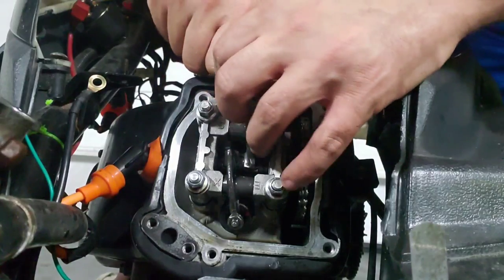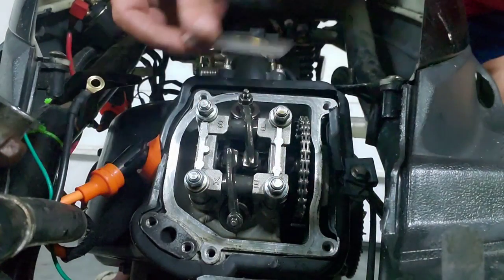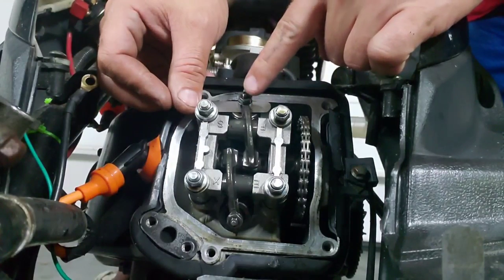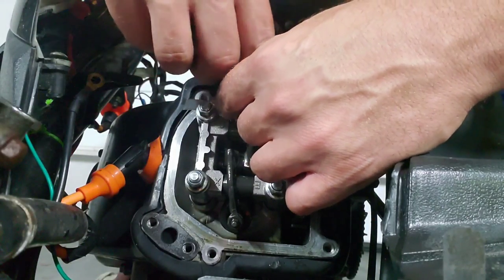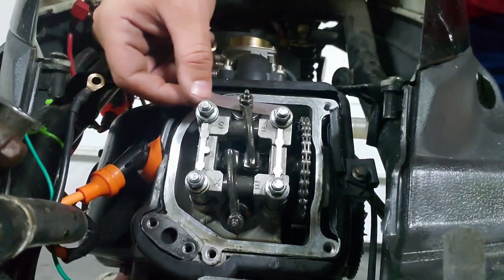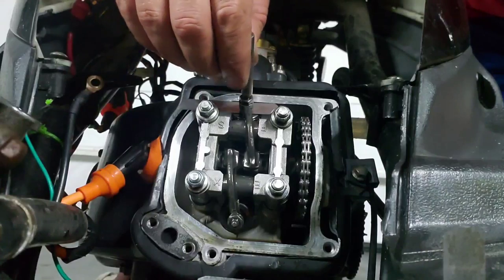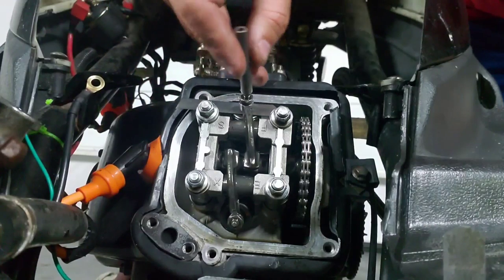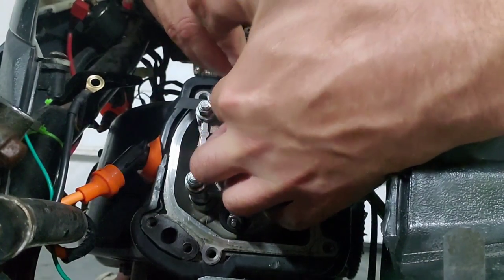Figure out which side we need here, crack it loose like so. Now to get me started I'm going to slide my feeler gauge in there. We're going to tighten the top one down - there's a nut that you have to loosen and the top one is what tightens for the valve lash. Sometimes this is kind of hard to do without holding it, so what I will do is tighten it down like that first and we'll check it. Then we'll take our T-rod here and we'll slowly just give it a turn and see if that makes it any better.